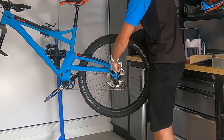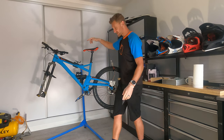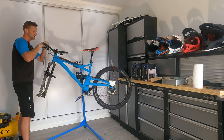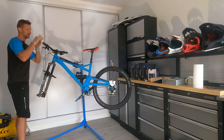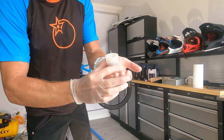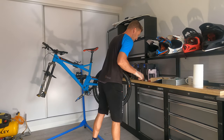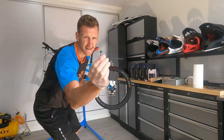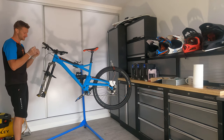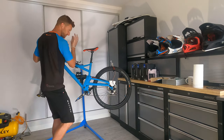Once we're at a good point, we're gonna shut everything off — turn that wrench, leave it nice and simple. Go to the front of the bike, pop the probe back in, compress that down nice and hard, and just undo this cup. There we go — some really nasty looking dark fluid. I'm gonna dispose of that sensibly. Back to the 2.5mm allen key — ever so gently, try not to knock the bike, and pop this back in nice and firm, so we're closed at the top end of the bike.